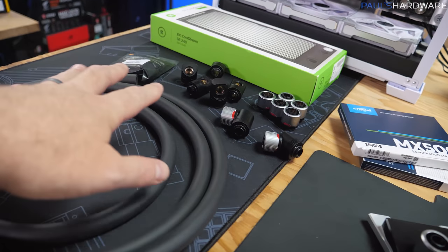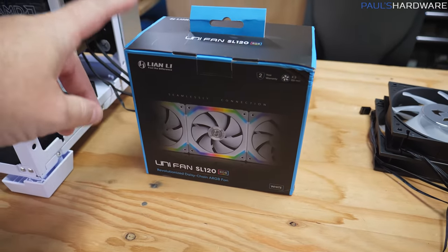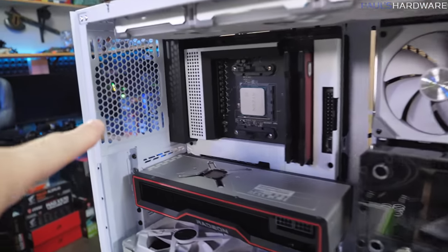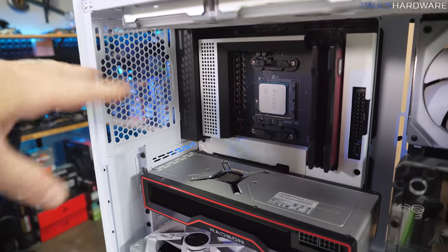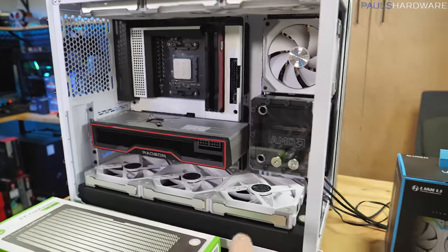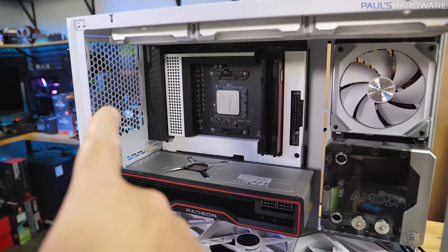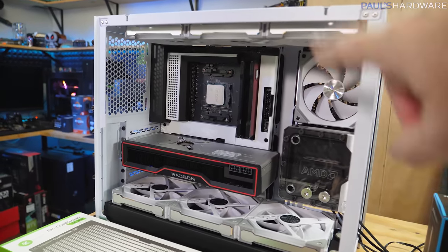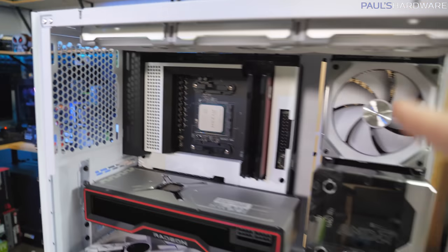There's a decent chance I might need extensions or extra fittings, but the one other hardware item I'm missing is one more set of SL120 fans, since many people pointed out I have an unused 120mm fan mount at the back. That got me thinking about airflow — right now I've got three intake fans at the bottom restricted by a radiator, and I thought maybe I should add an intake at the back to balance the two restricted and three unrestricted exhausts at the top and sides. But there's no dust filter there.